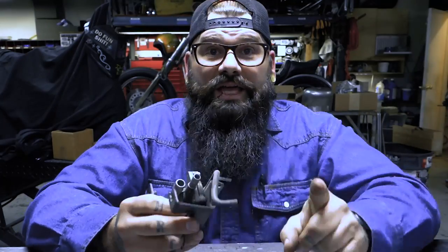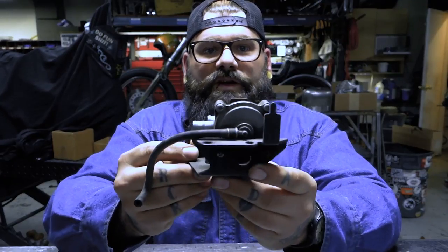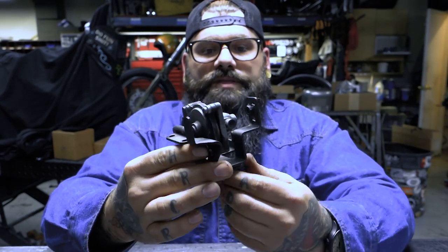So you're not going to get vacuum just sucking in atmosphere. If you don't plug that port, your rear cylinder won't work and your bike's going to run like crap. This is the AutoFuel Petcock AFP. Let's see if you guys can see this well enough — I don't know if the camera's going to focus for you. But that's what it looks like, and it's going to be situated on top of your intake between the cylinders.